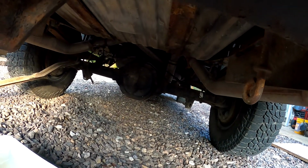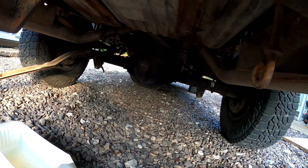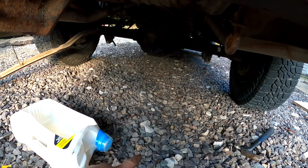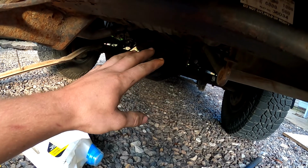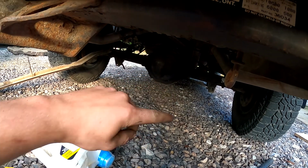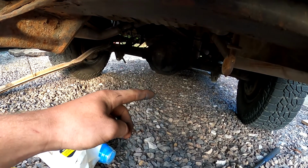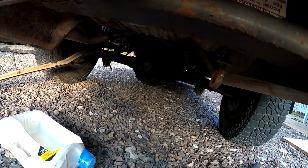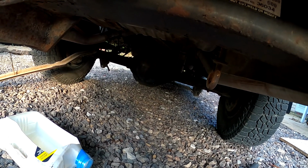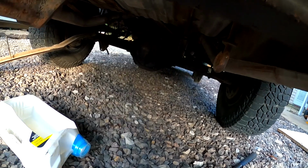I've already made a video on this rear end before, and in that video it showed there was some rust. What I'm thinking is that it wore out the area that was rusted, above the gear oil, when there was water in it, and the moisture rusted it, and now it's really starting to wear on that part. So I'm assuming that it's going to be in really bad condition. The reason I assume that is because the speedometer was tweaking, and therefore I feel like there's probably a lot of metal on that sensor.